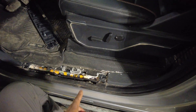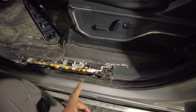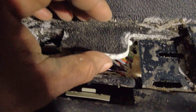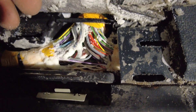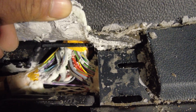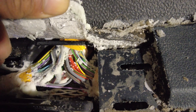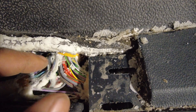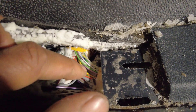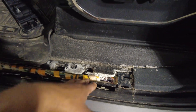What you see is this flaky crust, which is basically salt creep. This eighty- to ninety-thousand-dollar truck has salt all over the harness. This is bad because salt is conductive, and these wires are not marine-grade. The wire sheathing on this harness is probably automotive grade, but in this environment it would need to be marine grade — meaning a silicone-type sheathing that prevents salt intrusion, with tinned copper conductors. If you strip these wires, they're just regular copper.